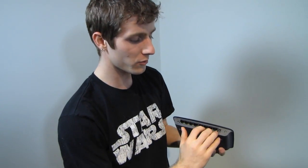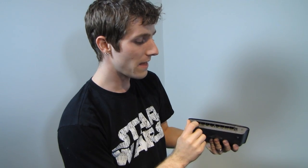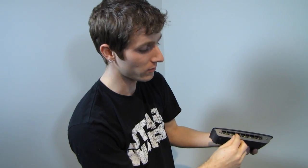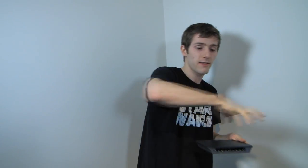That's what a switch does — you take one gigabit backbone and run it out to multiple gigabit devices. If your connection to the main network is through port 1, a computer on port 2 can communicate at full gigabit to that network. However, if three computers on ports 2, 3, and 4 all need to communicate through that one uplink, you're limited to a total of one gigabit — theoretically about 333 megabits per second each. But computer 2 can still talk to computer 4 at full gigabit speed within the switch.